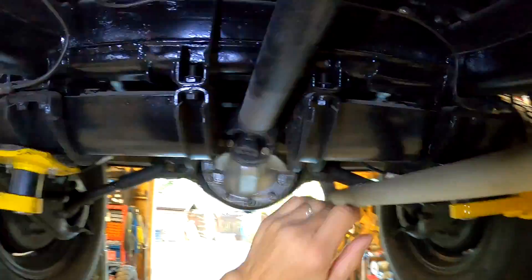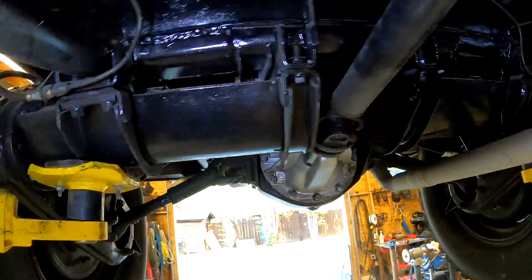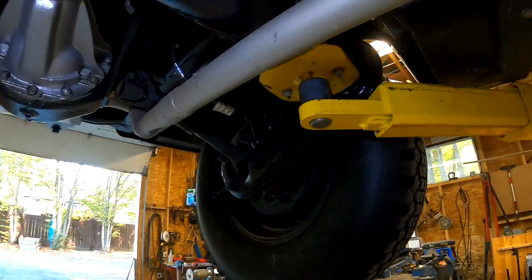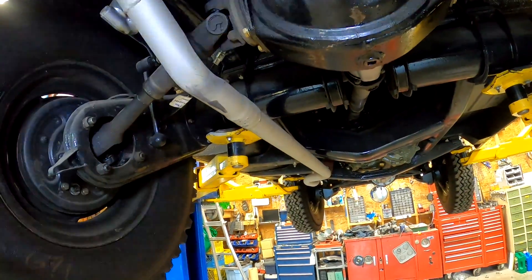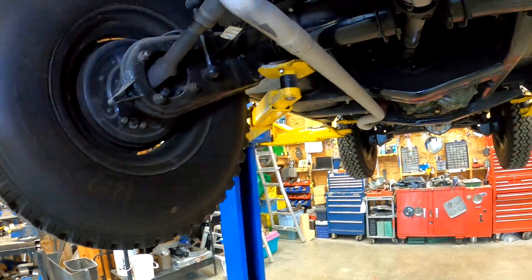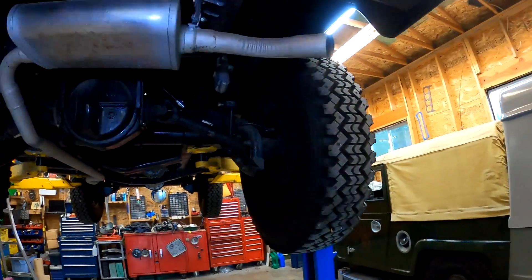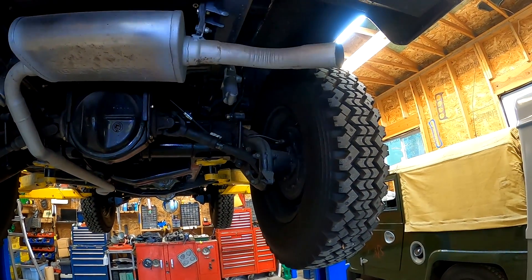The flexiter units here in the left rear and right rear — the only thing I find with this Gypsy being a pickup style without weight in the back is that it's very light in the back. Because they're designed to carry some weight, it doesn't articulate very well on twisty stuff. It's flexing and everything, but you can lift a back wheel pretty easy and make it spin. I think with a hard top like what this has, or if you had some weight in the back when you're going camping, a little more weight gives a little more traction.